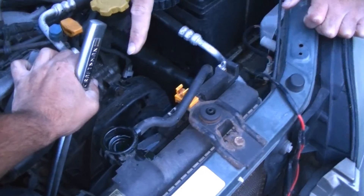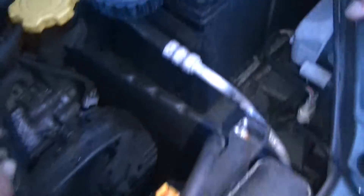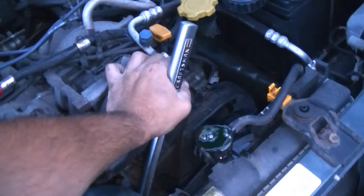If you look at the radiator, you'll see it starting to bubble out. So that is a telltale — we have a bad head gasket in this engine, and this engine is going to need to be removed and overhauled.